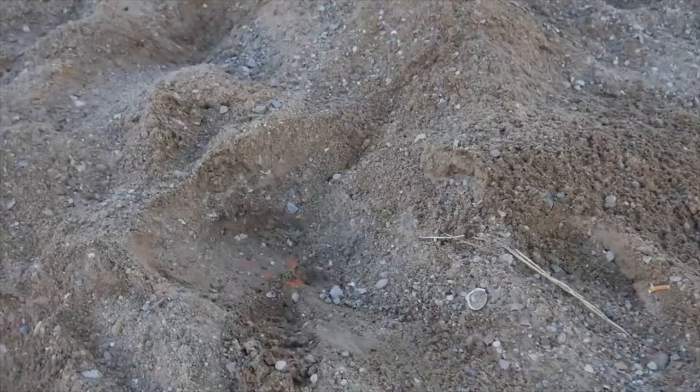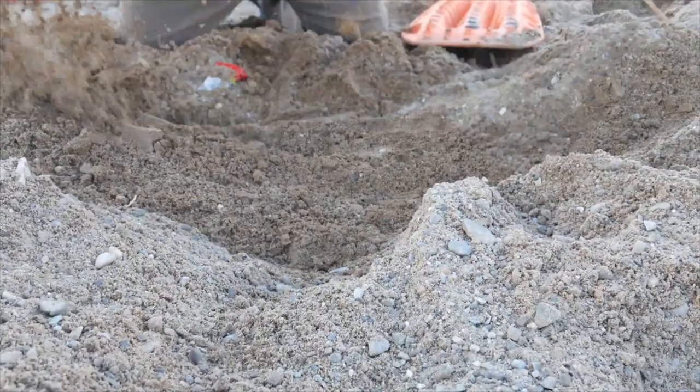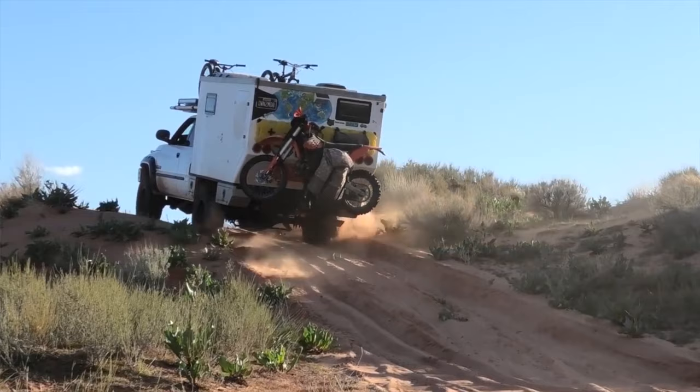We got this far — this Maxtracks is stuck. I just had to dig like 3 or 4 holes to even find it. It's so silly. That is my biggest tip for this video. If you haven't used Maxtracks and you're getting them and going into some deep stuff where it might get pushed — think about it, as you roll over, your whole rig just pushes that thing under. So put some leashes on, experiment with that. It'll save you time and potentially save your Maxtracks.